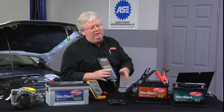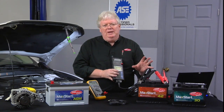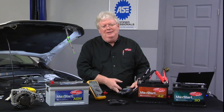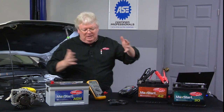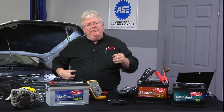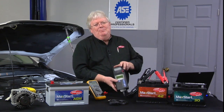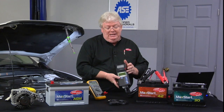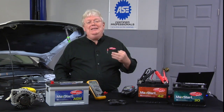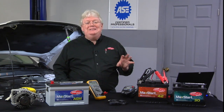It's very common for a brand new battery out of the box to measure significantly higher cold cranking amps than its specification. Once it's in the vehicle and subjected to a few loads, it will come down but should still be above spec — which is a good thing. If it reads below spec, that's when you consider how long the battery will last, which depends on variables like temperature and climate. For conductance testers that don't ask conventional or AGM, add 100 cold cranking amps to the label spec before running the test.